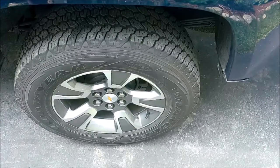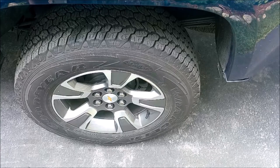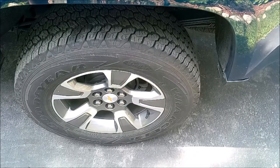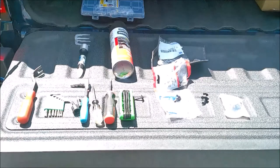In this video I'm going to show how I applied the second coat of undercoating to the wheel wells of my 2020 Chevrolet Colorado. I'll be removing the wheel well skirts and reinstalling them during the video. General Motors refers to this part as a fender splash shield. The reason I apply undercoating is because I live in Michigan, and in the winter we salt the roads. That road salt will rust away the body on a vehicle, and around here you'll see older trucks with the wheel wells rotted out. Undercoating is an affordable, easy way to reduce the likelihood of a corroded body.